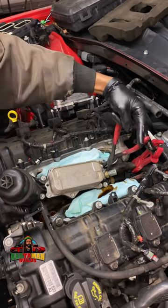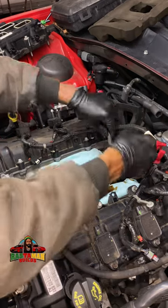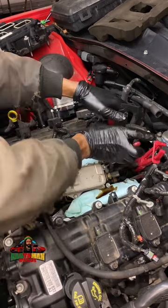When you pull this up you're going to have a coolant leak, and that coolant leak is right by the oil ports — so coolant is getting into the crankcase. But we're doing an oil change, so you have to set up your drain bucket.